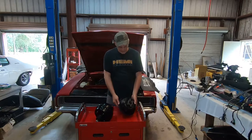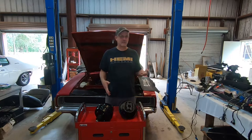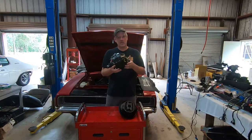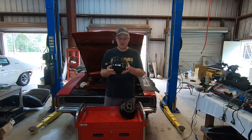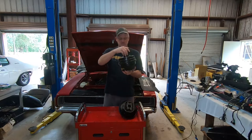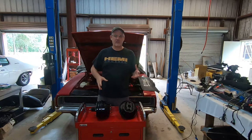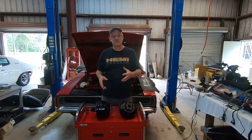So I'm finding out a lot of things I probably did wrong back then that I'm going to try to correct now. I've decided to go with the correct booster — this is a 66-70 B-body brake booster to use with disc brakes in the front and drums in the back. I got this from Classic Industries, got it on sale, and it comes with the matching master cylinder. I'm going to show you the steps, because this portion is a little bit bigger and we might have to round the hole out on the car. I'm also going to show you the proportion valve I chose from Master Power Brakes, and we're going to run some lines and hopefully get this thing dialed in.